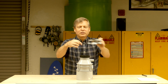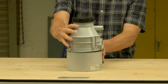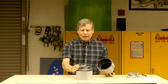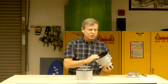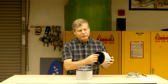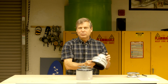The food goes in here and falls through this little rubber trap to keep unwanted things out of the garbage disposal. There's a water inlet here and a water drain there, and then inside we have the actual grinding pieces. There's a rotating platform with paddles on it that knock the food around to jam it up against the cutting ring. There's a cutting grinding ring around the inside edge, and when the food is ground small enough it can fall between the edges of this metal plate and the ring and be flushed out.